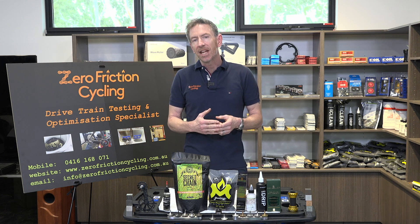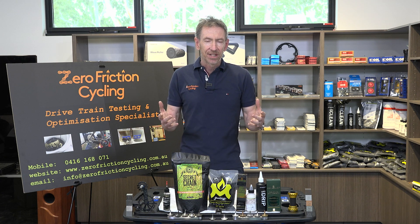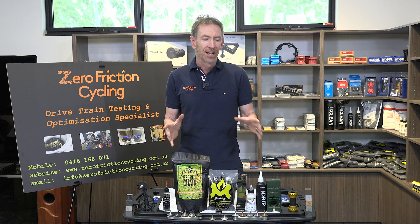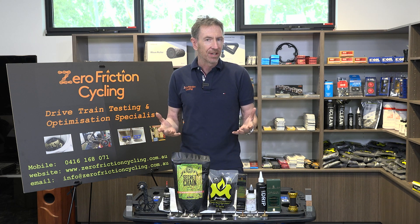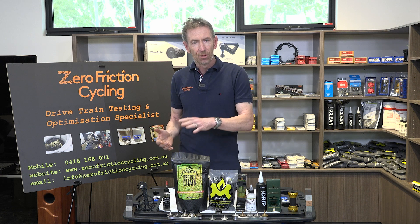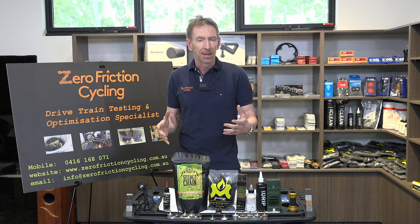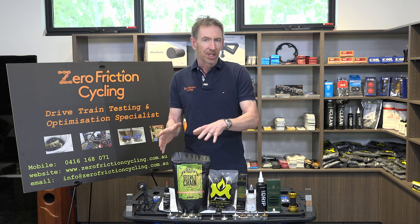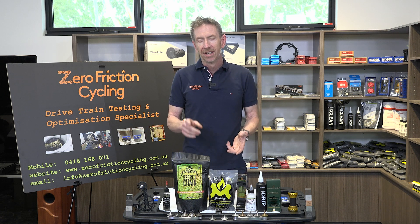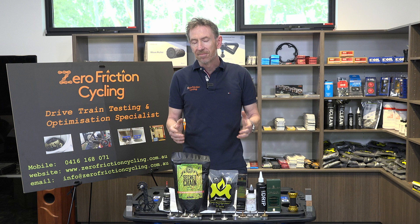That's a wrap on maintenance level one. I hope it's been more helpful than the usual content that covers all lubes with one maintenance type — they really are quite different. For a lot of the top ones, you just don't need solvents at all, and their contamination resistance is so good that if you've been on a traditional wet lube, especially riding off-road, it might really be worth considering switching to a chain coating type or immersive wax for a super clean drivetrain, super low wear rates — win-win-win.